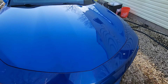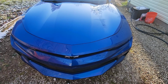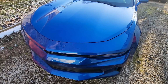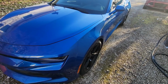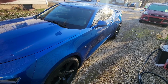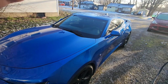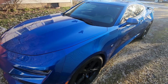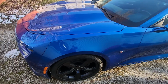Really, the second coat of the coating went a lot faster because this time, having some experience with it, once I did the hood on video, I did the roof and the trunk, the whole thing, both sides of them, in one shot. And then I did the entire driver's side, then removed it. The entire passenger side, then removed it. And then the rear end and the front end. And I had absolutely no issues whatsoever. I consider it the easiest paint protection I have ever used.